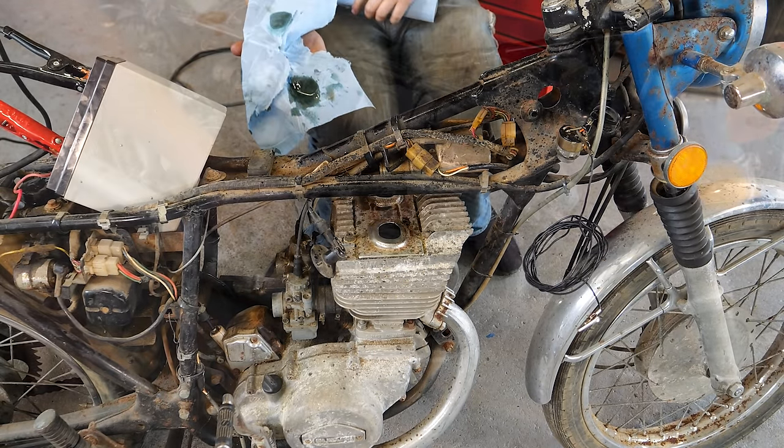But what you need to do is adjust your throttle idle speeds on each one until they are synchronized. So watch as I lower this. Yeah, there we go. Now we're getting a little closer to this one over here, and I can get something that I can find around here to measure those and make sure they're the same. But I bet, even right now already, if I fire this back up, it will not be idling up around 3 grand. And as you notice, I would rev it and it would zing and slowly come back down. Now, with these set at the right height on each side, it will come down much quicker because one of them was letting too much air into the motor.